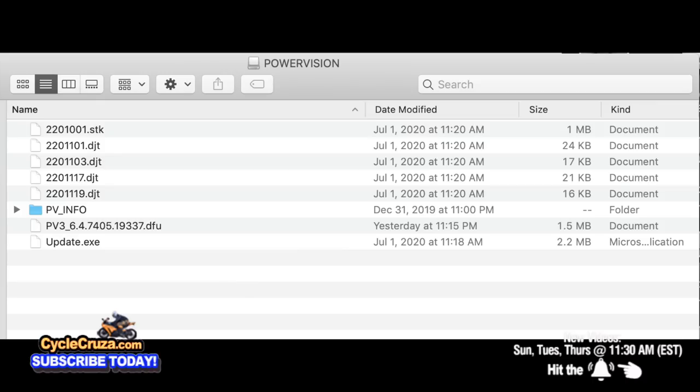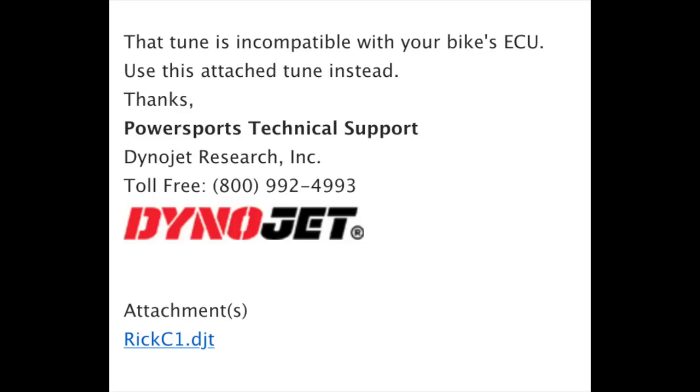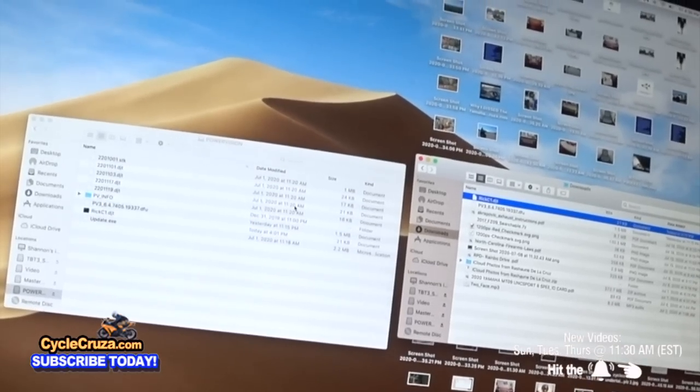So what I had to do is go ahead and email technical support, and I asked them to send me the tune file via email. So this is the response I got from the technical support agent. It says that actually this tune is incompatible with my bike's ECU. So he sent me the proper tune, and I went ahead and downloaded this tune onto my Power Vision 3. So now we're all set.